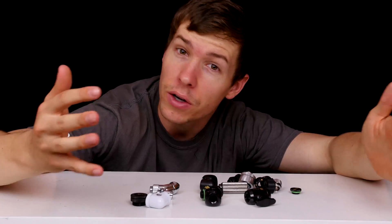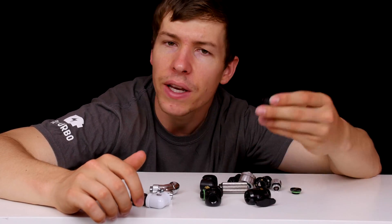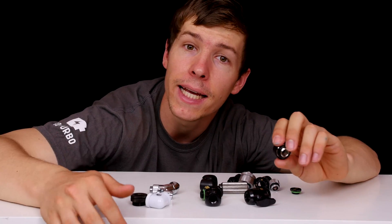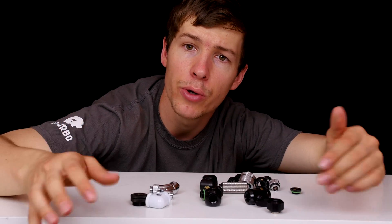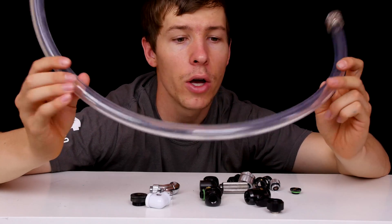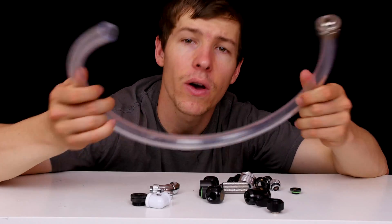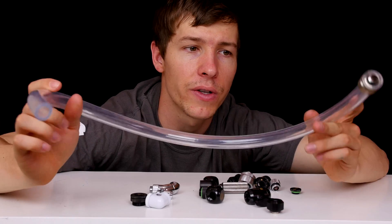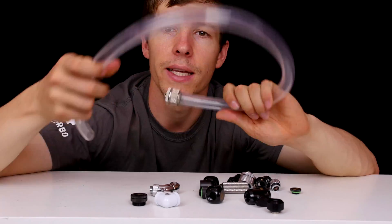What type of fittings do I get? What type of tubing? Do I go soft tubing or rigid tubing? By rigid tubing I mean tubing that is hard and fits into compression fittings — that includes copper tubing, acrylic, or PETG. Let's start with soft tubing, as that's what many beginners go for. Soft tubing comes in many sizes and bends itself, saving you time and money — you don't need 90-degree fittings if you don't want to bend rigid tubing, meaning fewer fittings in your build.